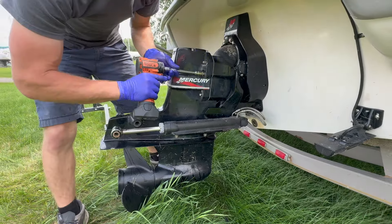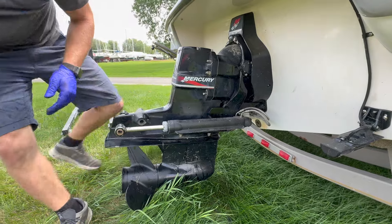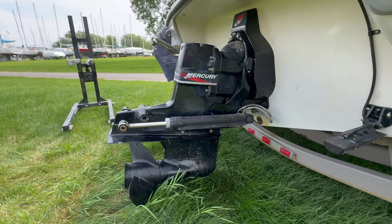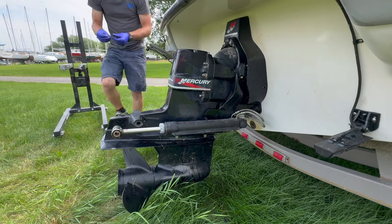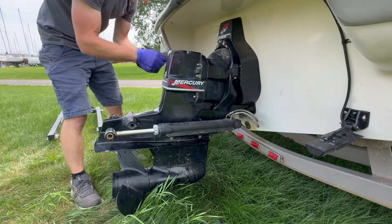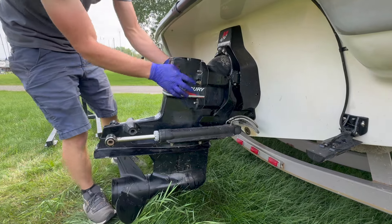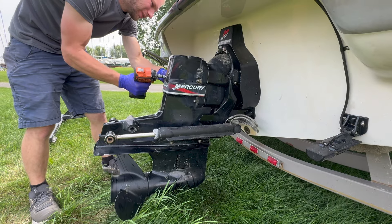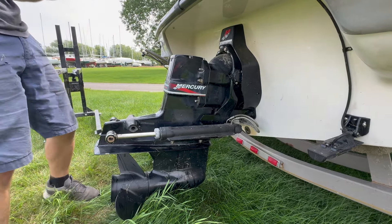This Alpha One seems much easier than the Bravo Three. I've just done a lot of them. They are definitely lighter. The main thing is to get these two center ones on, otherwise you always get gear lube leaking out of where your monitor bottle goes. No more leaks.